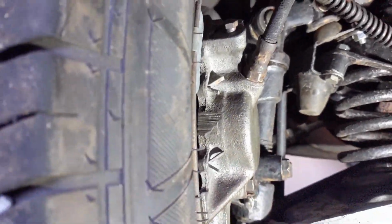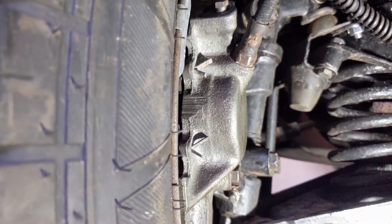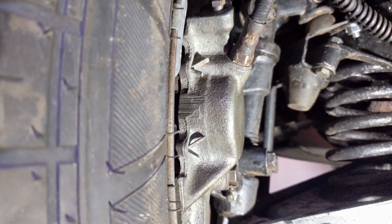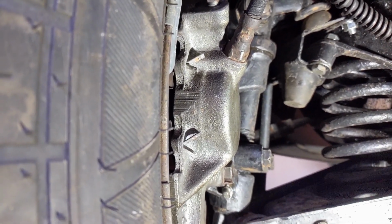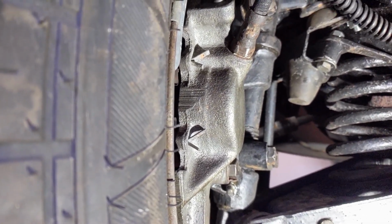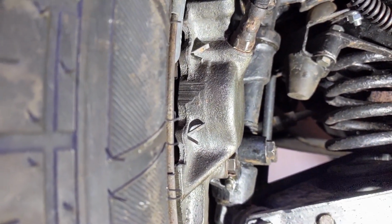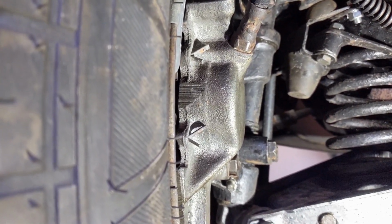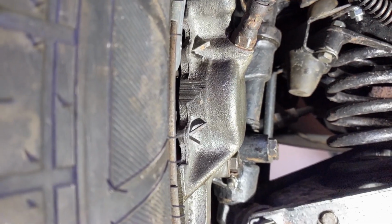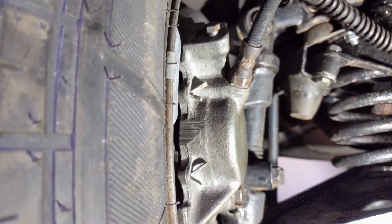Well, I think I'm totally screwed here now. That's just rounded off completely. Can't get it to shift at all. So I think that means I need new flexible hose and new. I mean, I might be able to get it off once I get the caliper off here, but I think we're talking about a new flexible hose and new caliper now.